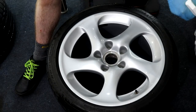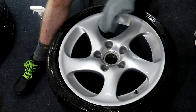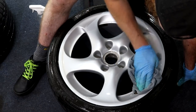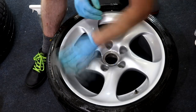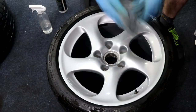The final preparation stage is to wipe the wheels down with IPA in order to remove those polish oils and residue so that the ceramic coating is able to make a direct bond with the clear coated surface. The tyres were given a secondary clean with IPA in order to remove any final traces of grease, previous tyre dressing or dirt in general in order for the luxury Swissvax tyre dressing to make a proper bond and last for weeks and weeks.